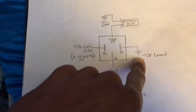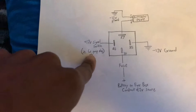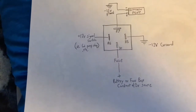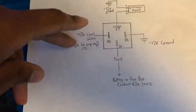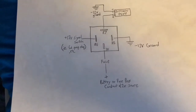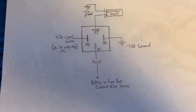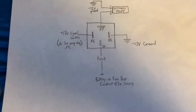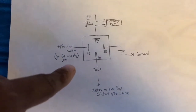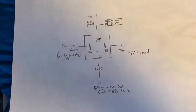The ground of the intercooler pump I'll probably run to the same ground as pin 85, so I'll just tie those in together and connect both to that ground terminal in front of the fuse box. For the switch source, I was thinking about trying to find a fuel pump relay — basically you need something that's only on when the car is on or running. A fuel pump only cuts on when the car's running, so that's why I like that source. I'm not sure if the car has a fuel pump relay up there. If not, it'll probably just be an ignition source fuse. I know a guy on YouTube — bone crusher — I think he ran his to an ignition source. I'll also have a fuse right here between the constant 12-volt positive source and the relay.